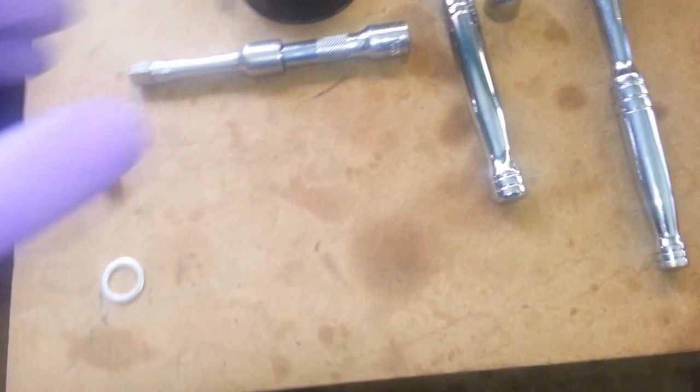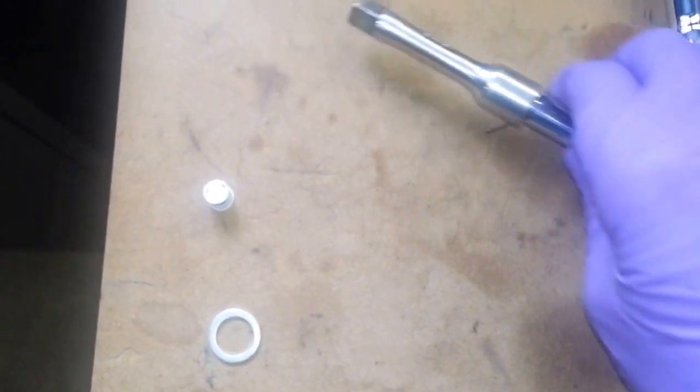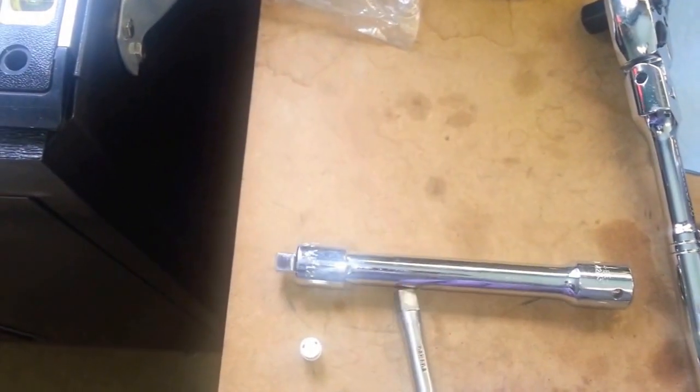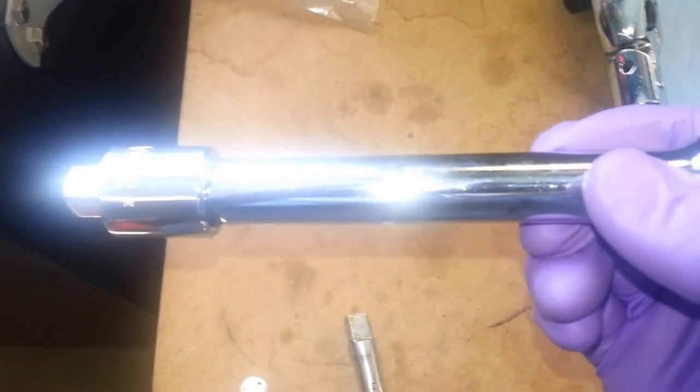Okay, I just wanted to make a note here on when you're installing the transfer case fill plug and drain plugs and the rear differential drain and fill plugs. I'm not going to go underneath the vehicle again because I don't have my cameraman here, and this is going to be too shaky, so I don't want to make anyone nauseous. But to take out the transfer case plug that I showed previously, if this is your exhaust pipe right there, you're going to go above the exhaust pipe. You don't have access anywhere else. You have to go above there.